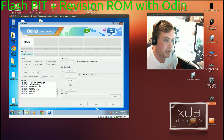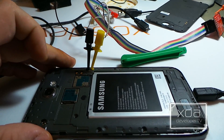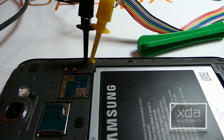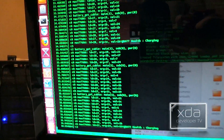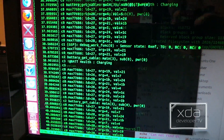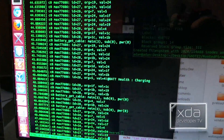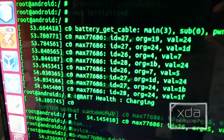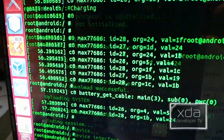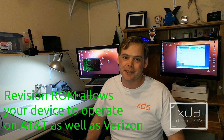This is a rather long flash, so while it's flashing, let me show you a hardware exploit we came up with. I'm charging my Verizon Galaxy Note 2 with some UART attached to it. This UART is hooked up to a couple of pins inside the device, and here is the data coming out. Remember, we're charging the battery, and the kernel is loaded on Samsung devices when the battery is charging. And that is indeed a hardware root UART prompt. Bam — your carrier is unlocked. That's all there is to it. Now let's move on to unlocking the bootloaders.